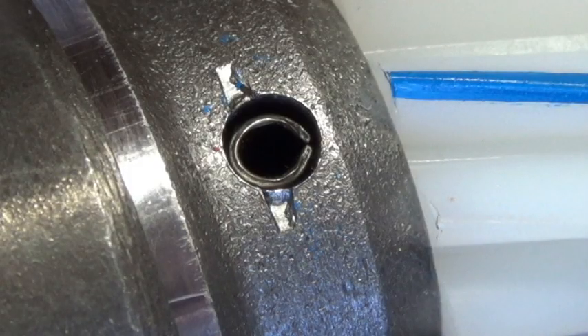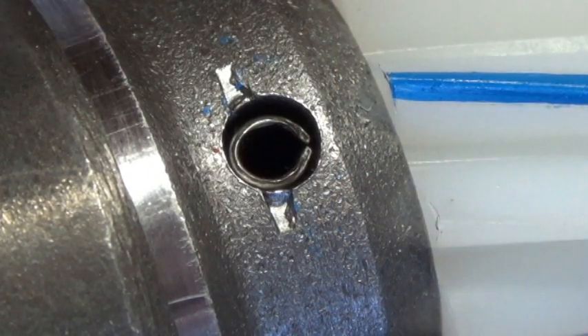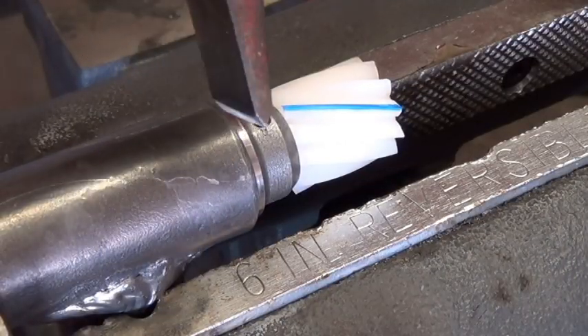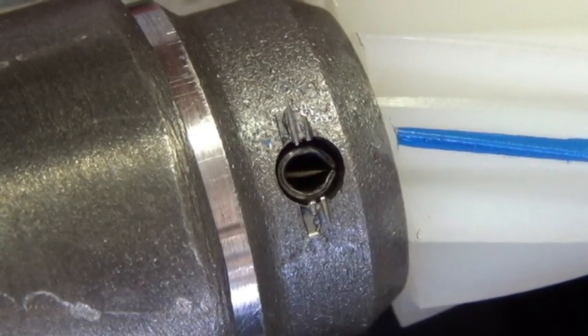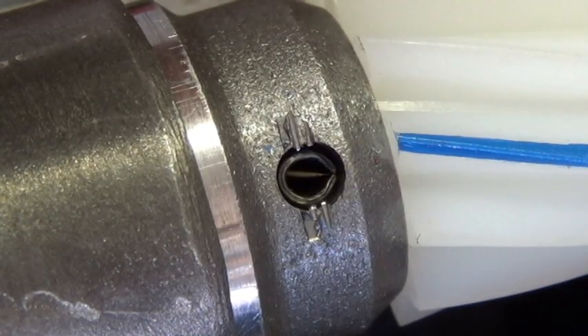The pin is now below flush on both sides. Taking a closer look, we can see the witness marks on both sides of the bore where it was previously staked. This is done in an attempt to keep the roll pin from coming out of the bore during transmission operation. Take a chisel and center it right over the bore, then hit it smartly until you have metal protruding into the bore. Repeat the procedure on the other side.